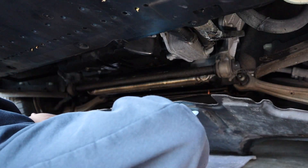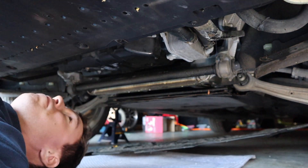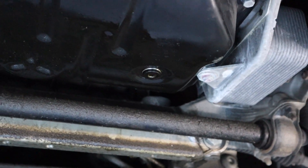I like to take the mat and slide it back underneath the car. Next, you're going to take an Allen key — I honestly don't remember what size it is, but if you have a set you can just trial and error until you get which one's right — and then loosen that oil drain plug.